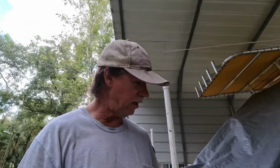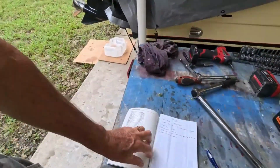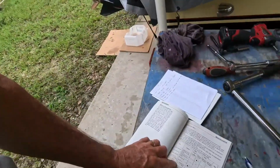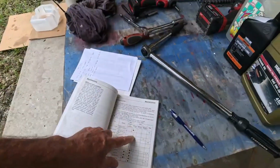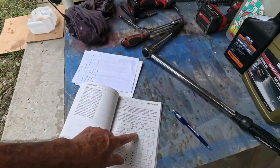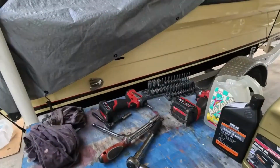And in fact, in an owner's manual, which I have here so we can see, they've got a full page on maintenance, and it's very descriptive. It tells you step by step what to do. Here I'm just coming to my 100 hours and I follow it down. Here, number one, anodes, external anodes. It says 100 hours, inspect or replace if necessary.